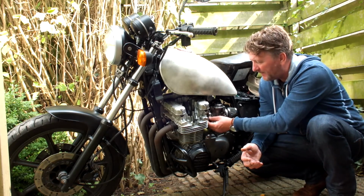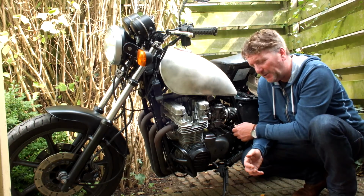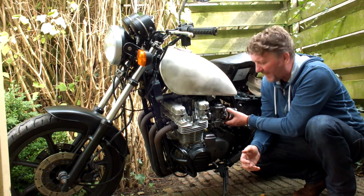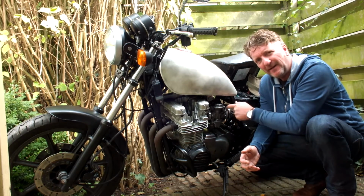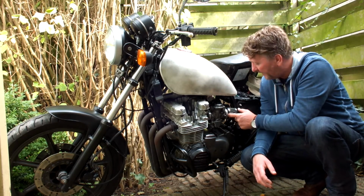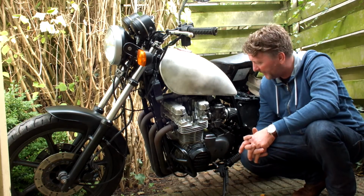I did my best to make sure I don't have any air leaks, but I'm going to need 4 new ones. Besides that, what is an issue is that these cheap pod filters don't really fit snugly onto the rubber ring, which means that you can get air leaks on this side of the pod, and so air could be leaking in behind the pod. So that's something I'm going to have a look at. Maybe I'll change out these pods for a little bit more expensive filter.